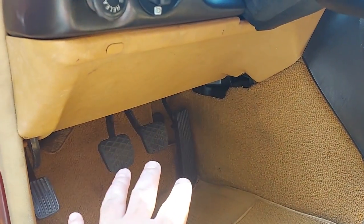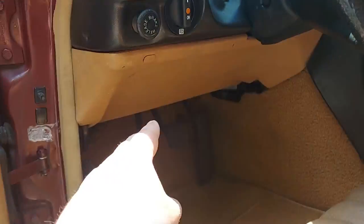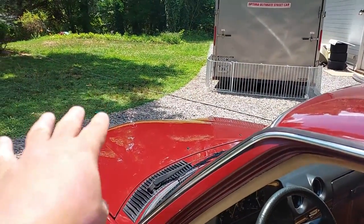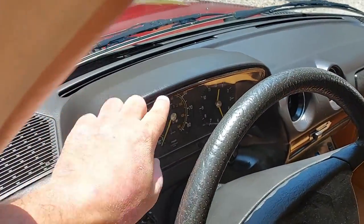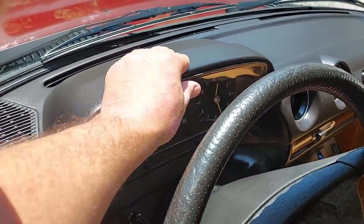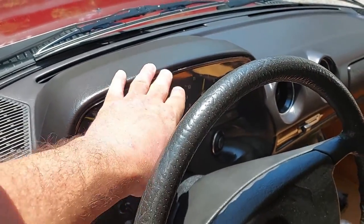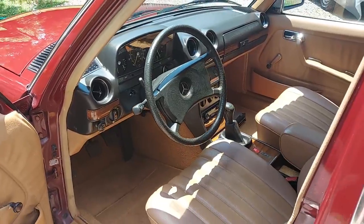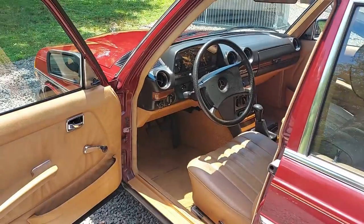This panel has all been out and I've replaced the cruise control module. I also replaced the cruise control actuator under the hood, and actually pulled out the gauge cluster — you can see right there the lip sticking out a little where I pulled out the gauge cluster and plugged back in the speed sensor, which was unplugged. So I had to do all that to get the cruise control to work perfectly. I ordered the cruise control module from Beckman Technologies.